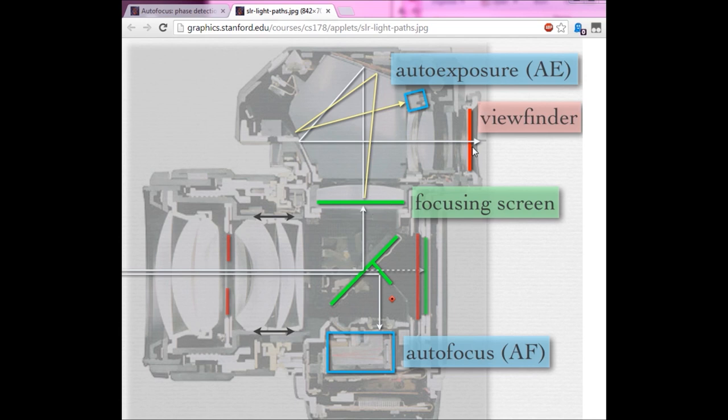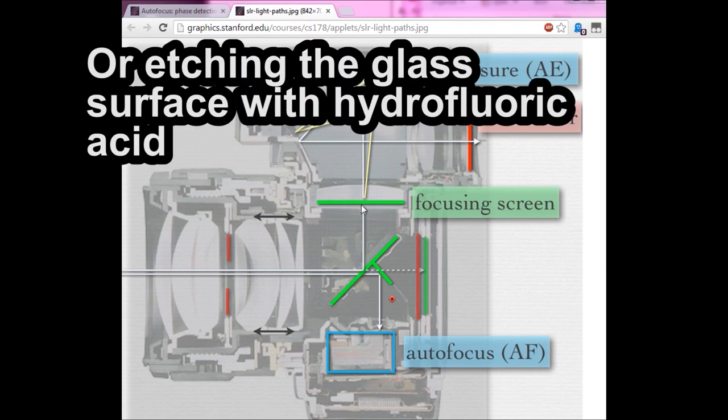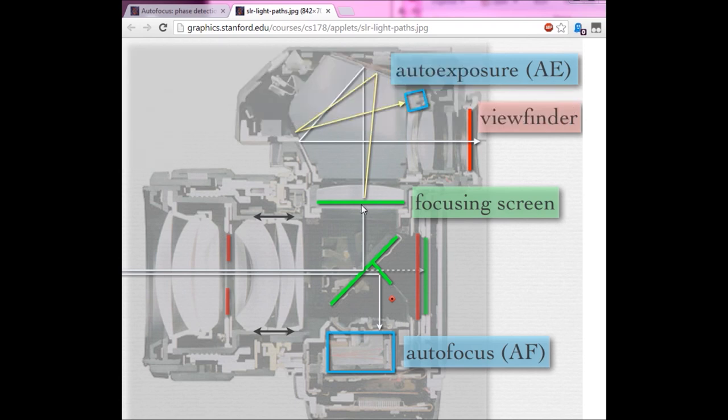What you're looking at through the viewfinder is the image projected on this surface. It's a transparent surface, basically frosted glass. It's done by grinding the surface of the glass with a very fine abrasive, but it effectively looks like frosted glass. When you adjust the diopter, you're tuning this lens system, which is basically just a way of looking at this surface here.